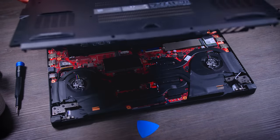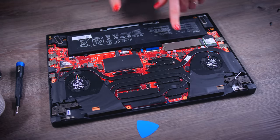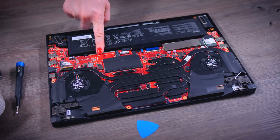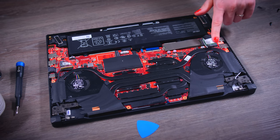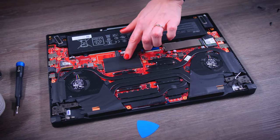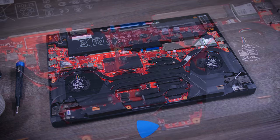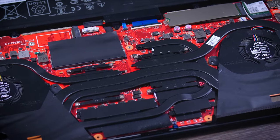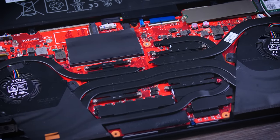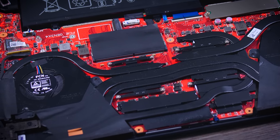It's very easy to open up this laptop to clean the fans or replace the battery. You can replace the SSD or add a second one, and even the Wi-Fi 6 card can be replaced if needed. The only downside is that half of the memory is soldered onto the motherboard. For a laptop of this form factor that's not too bad — most versions will ship with a dual-channel 16GB 3200MHz kit by default — but having the option to replace all of it would always be better.